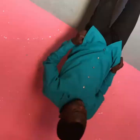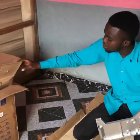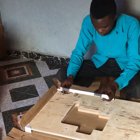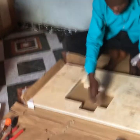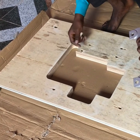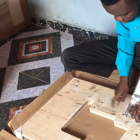Pause. The thing we are doing now is we have to fix this guy. You get this from the machine head carton, always a case there that you just open and bring out. Now, if you notice, there are different holes on your table: 1, 2, 3, 4, 5, 6. Now, the holes must be 7. Same thing happens here again, one of it is covered, so it must be 7. This guy is using 4, while your clutch motor is using 3.